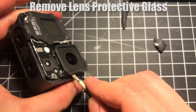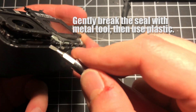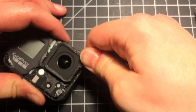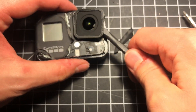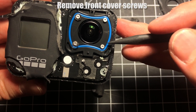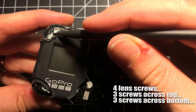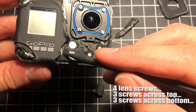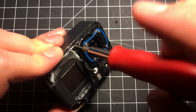You need to get that lens cover off, and you can use a metal tool to gently pry until you break that seal, then use your plastic tool to finish the job. That way you can get it off nice and safely without damaging your lens. With the lens cover removed, you can now start to remove the front cover screws. There are four lens screws, three screws across the top, and three screws across the bottom. These are Torx screws, so get out your small Torx screwdriver and begin to gently remove them one by one.